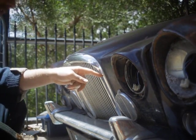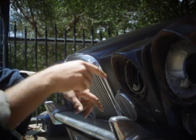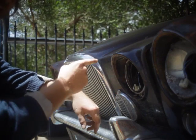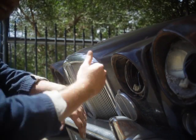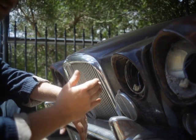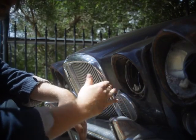The headlights were broken for a long time. And I actually found out how the wiring for these headlights works, because I looked at the wiring diagram. I found out that the fusible link for the headlights doesn't start at the battery. It actually starts after the electronics in the dashboard. And looking at the wiring diagram, I found out that the dipper switch is a junction box that switches between main lights and dip lights, and it actually routes the signal between the two.